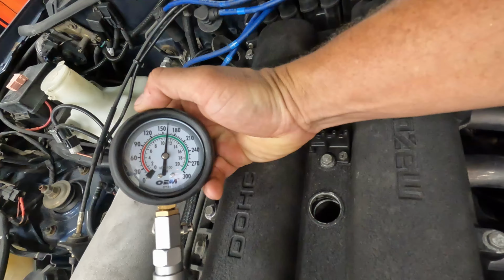So I've got a push start. I'm able to turn the motor over without the fuel pump going. I don't think this thing had... no, it's got a fuel injector. So, what is that? There. It's like that 30 amp fuse at the bottom. Fuel injectors. I would pull that, which we might as well pull it. Oh, if I can.